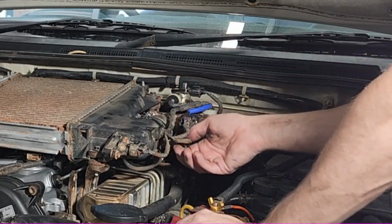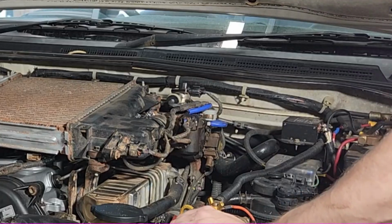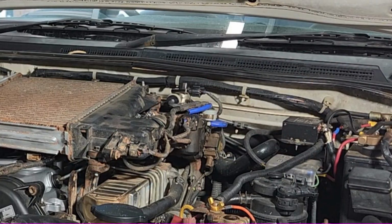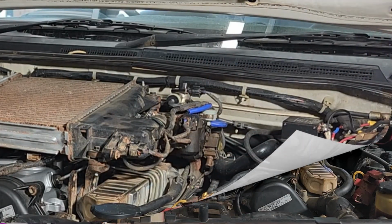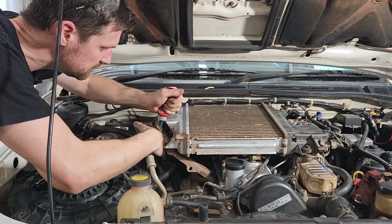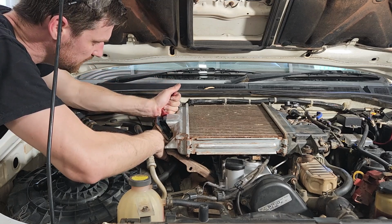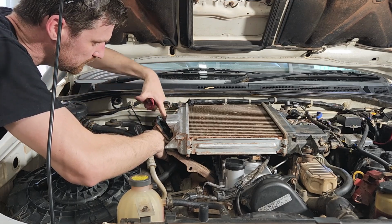Once all these are plugged in, we're happy everything's secure where it should be. That's tight. I'm going to put the 4 bolts in that end there with a little bit of that Loctite gasket maker and just nip them up. All right, we can just push this out of the way and just put a little bit just around the face, just to help it seal a little bit. We don't want any dusting going on. We can avoid it.